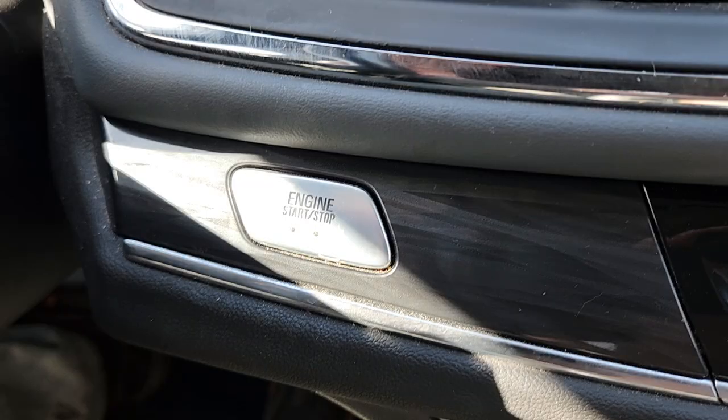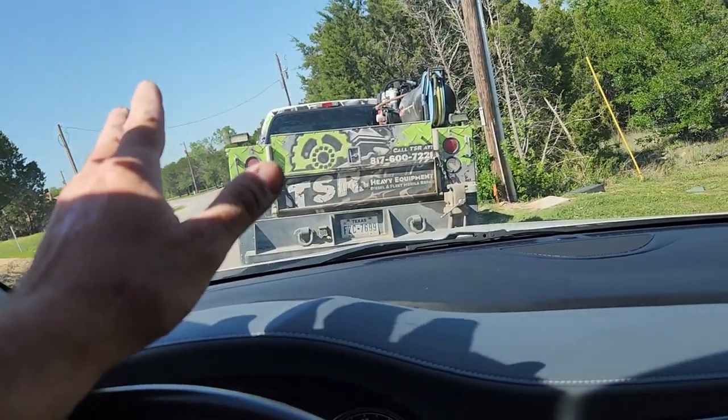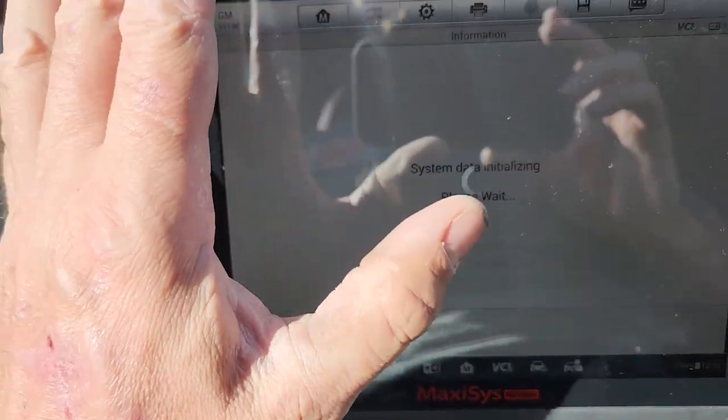So you have to do something with it - you run your tank vent all the way up into your intake and you just vent it right into the intake. But you can't just run a line straight to the intake because then you're running on fuel fumes and that's a problem. So you have to have a valve in between the two - the purge valve is on top of the engine. Purge valve gets stuck, you got a problem. You also know you got a purge valve problem when you go to fuel up the car - for some reason all of a sudden it just has this really really long crank, and it takes forever to crank.